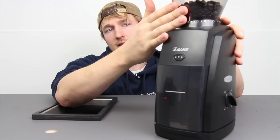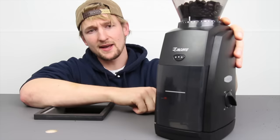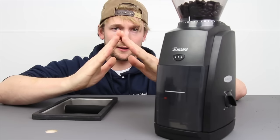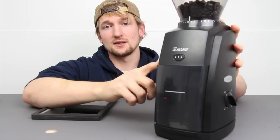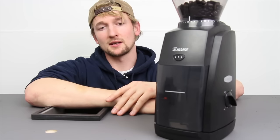You might notice the hopper and bin don't quite match on this Encore — that's because we've made a change to help everyone not overfill their bin. We now have the bin clear like the hopper, and we've added a fill line that's about two-thirds of the way up — not at the top. That's because coffee falls from the discharge chute into a single spot, building a pile, and the tip of that pile can reach the top of the bin and cause a clog if it reaches the discharge chute. This updated bin is available on our parts page and ships with new grinders. Thanks for watching and I hope you're back to grinding.